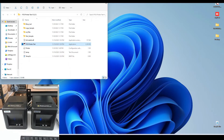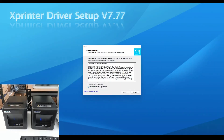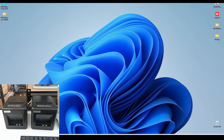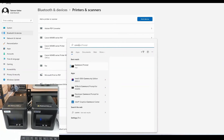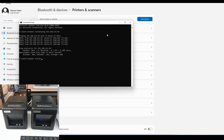After this we need to install the drivers again for this second printer. Once installed, go to Printers. We can first check in Command Prompt and try to ping the IP address 192.168.123.99. That's successful — we are getting a reply from the printer.